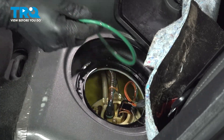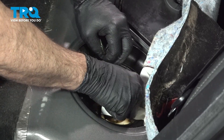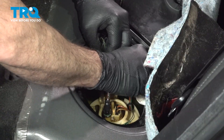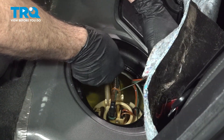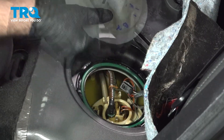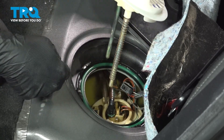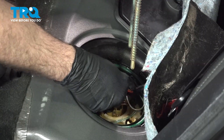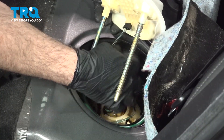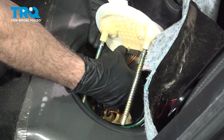At this point, we're going to remove our O-ring. Go ahead and clean up any residual fuel sitting around the perimeter. Make sure that the groove where the O-ring is going to be placed is clean and free of debris. Take that new O-ring and set it into place. When we removed this, we made sure this tab was facing us and we know the connector pulled off towards us. So line up your fuel pump, install your connectors — they can only go in one way and they are two different connectors so you cannot mess that up. Make sure you feel and hear them snap into place, and give them a little tug to make sure they're secured.